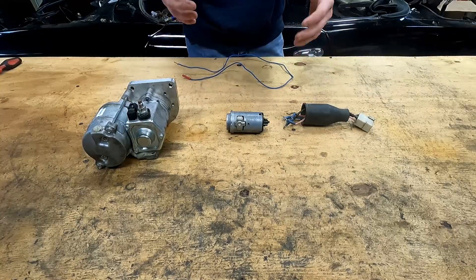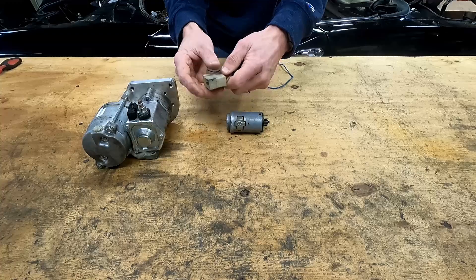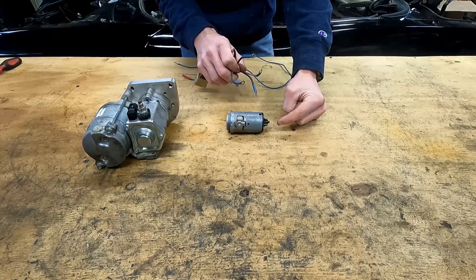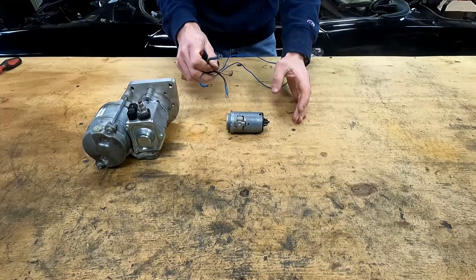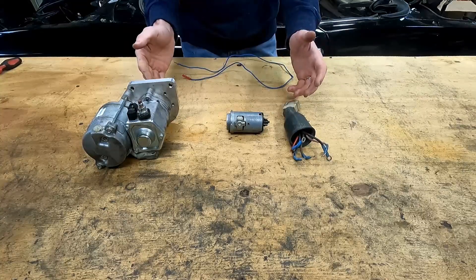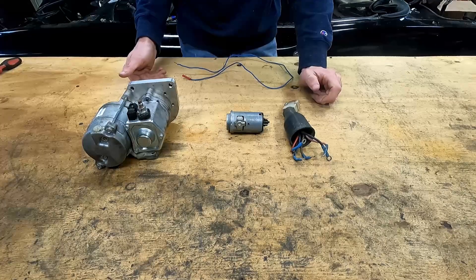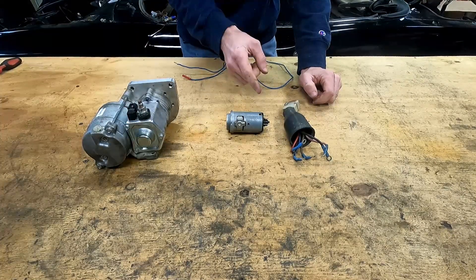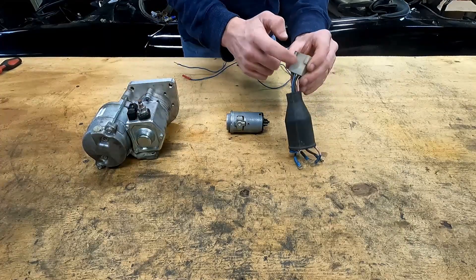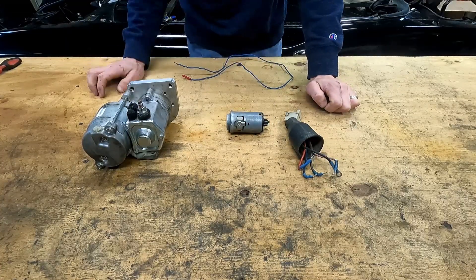The brown wire basically provides power from the starter stud up through the plastic connector, then through the brown wire, which attaches to terminal 30 on the back of our ignition switch. This is where all the power for the car comes through - it's all funneled from here through that brown wire through the connector onto the terminal and through the switch. This is a really common place for failure and electrical problems on these cars. The best fix is to use the extra number 30 terminal on the back of the ignition switch and run it directly from the stud of our starter, skipping the connector entirely to avoid resistance and heat.